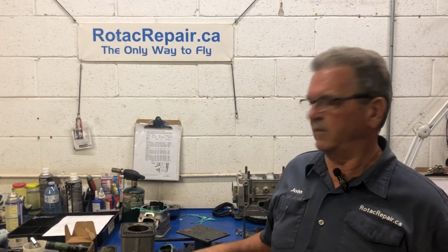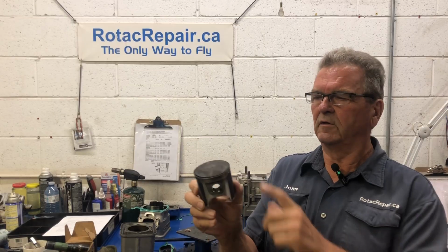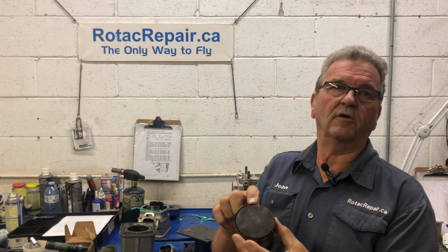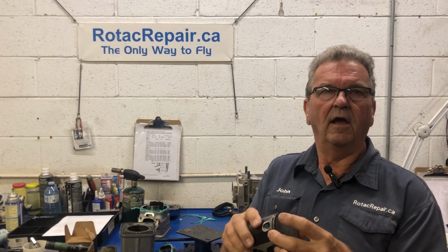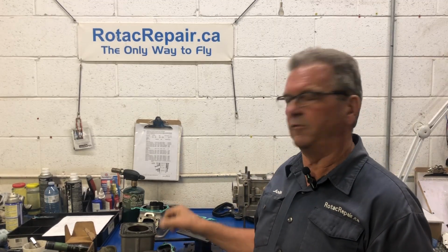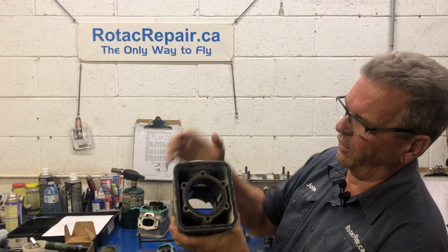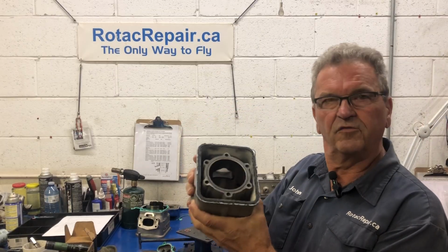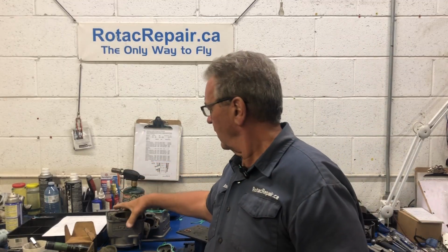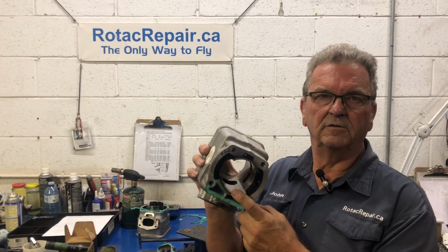So what did I find here in the end? This all started out with these aftermarket pistons and rings. The wrong ring package for an engine that's going to run at high RPM all the time. It looks to me like it has a chrome top ring and just a plain cast second ring. It should have moly coated piston rings in it. So totally wrong. The heat generated with all of that friction, I don't know if you can see it in here, but where the cooling system part is, there's just a line across there. This thing was so hot with so much friction from the ring package. And very not the proper angle on the crosshatch on the cylinder.